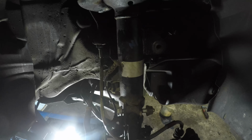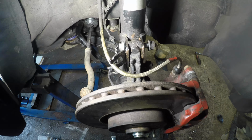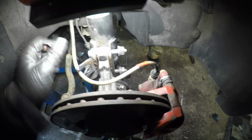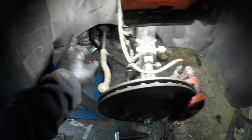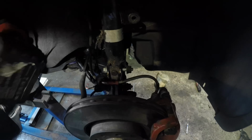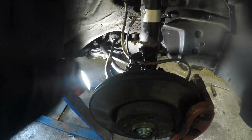Smooth a little bit. Okay. So, can't remember why I did this on the other side, but there you go. That's where we are. We put a new bolt in there because I didn't like the look of the original one, which happens a lot. But all we've got to do now, and I'm not going to, these are going to remain loose until I've done a few other bits and pieces. Right, anti-roll bar drop links. Yes, we've got new ones. So we'll probably do those next. I think that's a good idea, yes. Anti-roll bar drop links, why not? Why didn't I think of that first, yes.